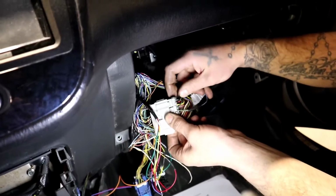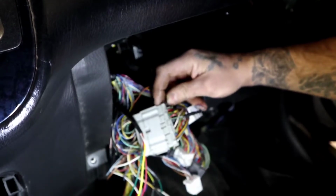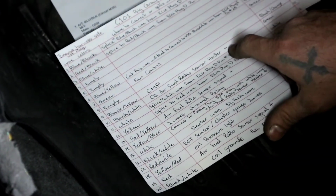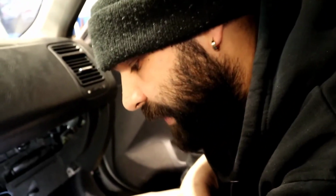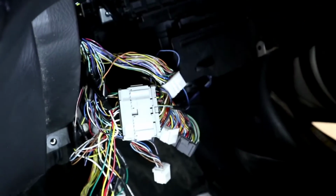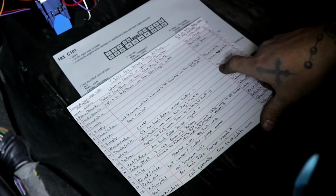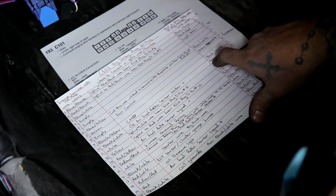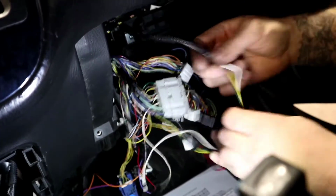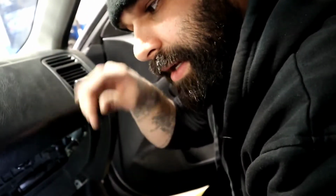Our number 10, which is the last one, is going to be, on the engine harness side, a black with a white wire, and that's our O2 air fuel ratio sensor heater, the minus side of the sensor. That guy is going to be connected to our opposite side, and on our opposite side I wired in a green wire, and that green wire leads all the way to the wiring harness that I made for the O2. I'll show you guys this, and I'll explain it afterwards in our O2 primary wiring schematic.